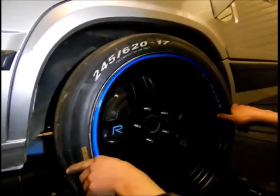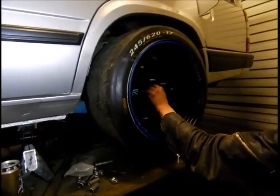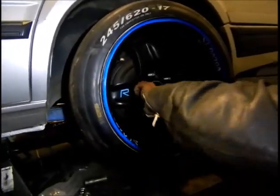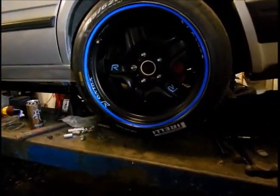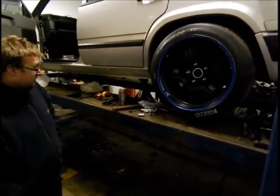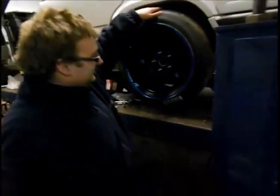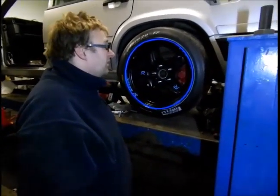That's on high and it's pretty good actually - that's not even with the full weight of the car on it. Drop it down on its own weight and see what it settles at. The shock bolts are all the way in but not fully tightened. That's fairly good - it is catching on the axle a bit. That should be all right though. I don't want to go any lower than that.